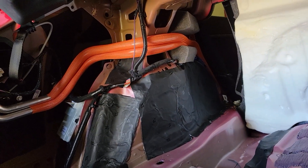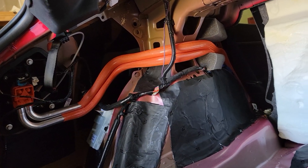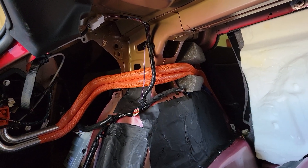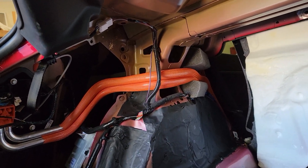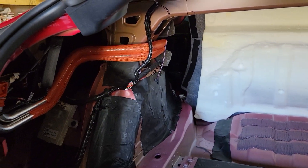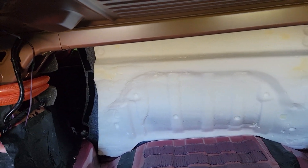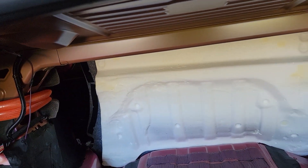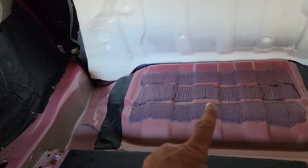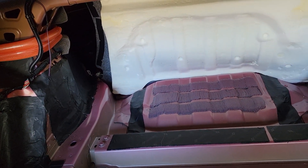I'm trying to isolate or dampen all the road noise coming through the rear wheel wells, which seem to be echoing and vibrating throughout the car in spite of there being seats and mats. Clearly the factory put acoustic material on the bottom of these mats. They also put horizontal strips — those are sound deadening mats of their own — but they minimize it for weight and cost.